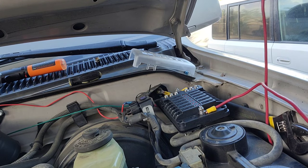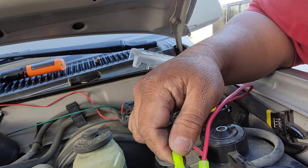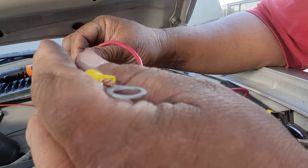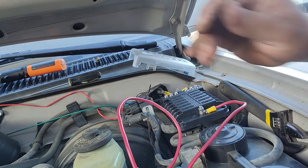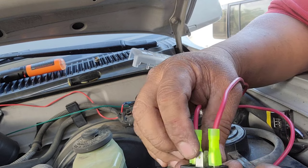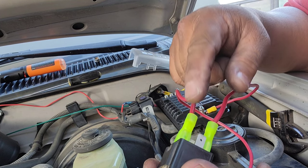This wire right here will go to pin 30, because that's where I'm going to supply power to my relay — 30 to 87. Then this wire going to pin 30 is going to connect to my battery terminal. And these two blades here — one of them is going to go to my fuse box inside the car, and the other is going to go to ground.